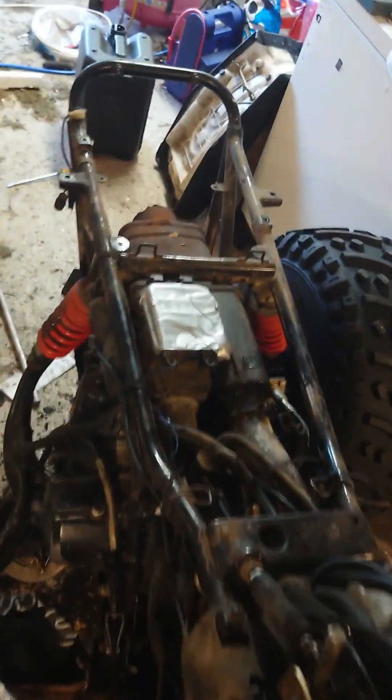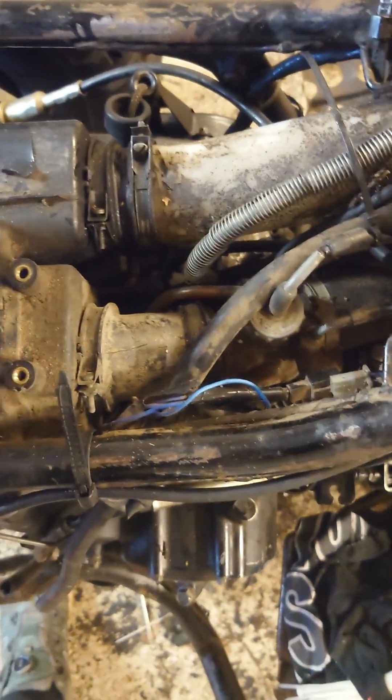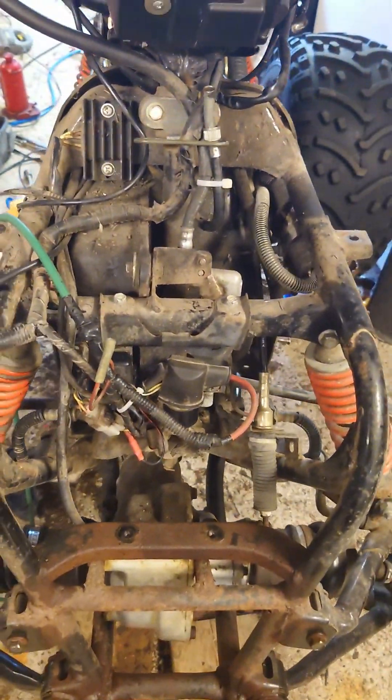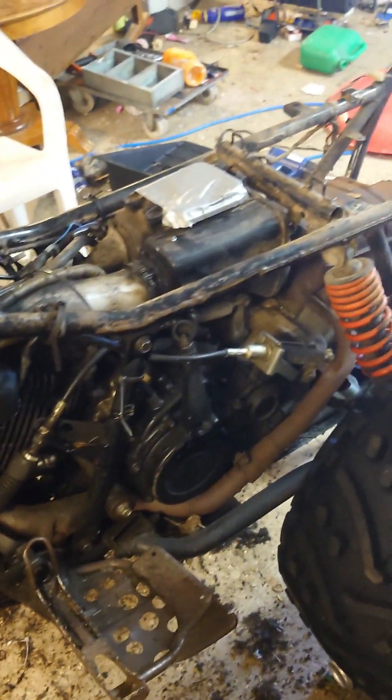I did though fix the starter button on it — it was just some switches. The motor back here, you can see things running down there and under the air box. I took this cable here, the blue one, grounded that button, and now I can use it to start it.